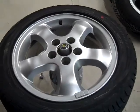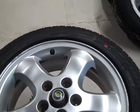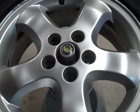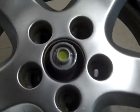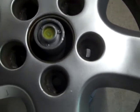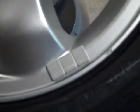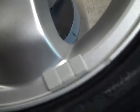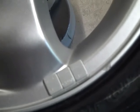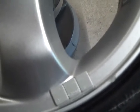Wheel number four — this is the one where I had the red dot furthest away from the valve stem. It was pretty centered, and if I were being lazy I'd just let it go, but the bubble was just a hair off within the center. I experimented a little and found that three-quarters of an ounce right here will do it.